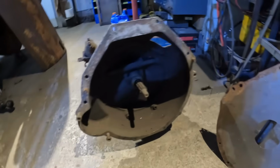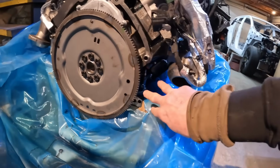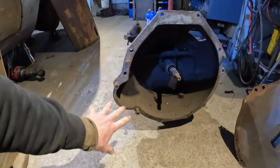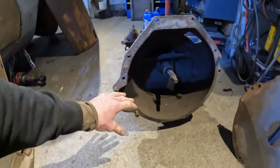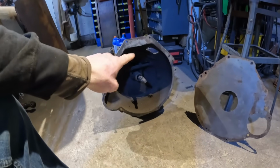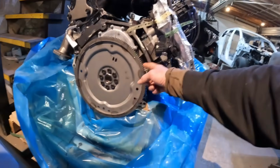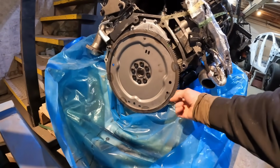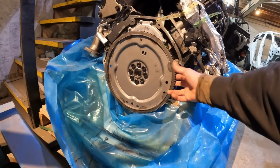That's step one. Step two is the starter. On the modular bolt pattern, it would have had a 3-bolt starter on the outside here, but if I use the ZF, then I'm back to the old school 2-bolt starter style, which is fine. I think you can just get a high torque new style starter, and that'll work fine. The Cleveland also had a 164 tooth flywheel. The Godzilla also has a 164 tooth flywheel. So I'm hoping that the starter, when it's in this position, will align fine to the Godzilla position on the ring gear, or on the flywheel at that time.